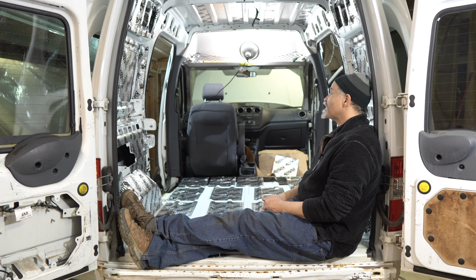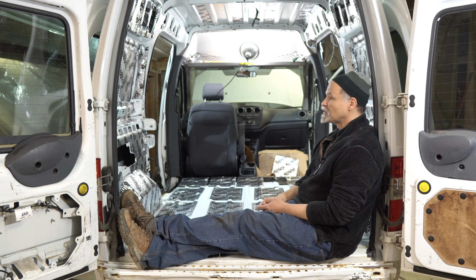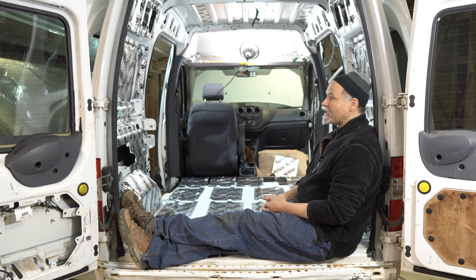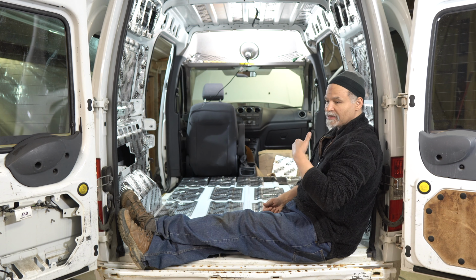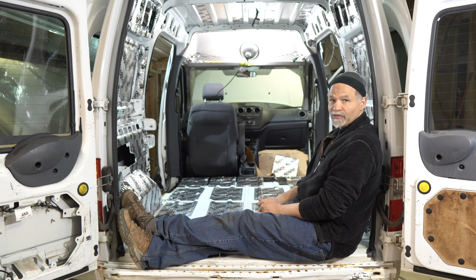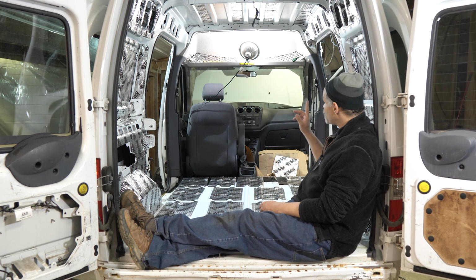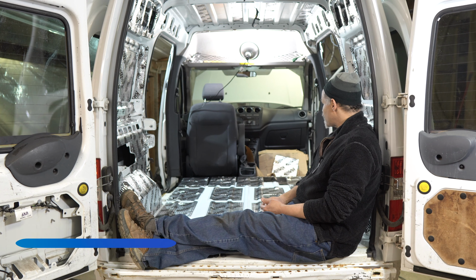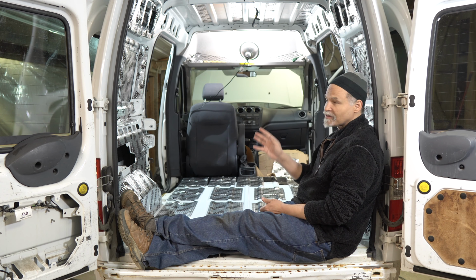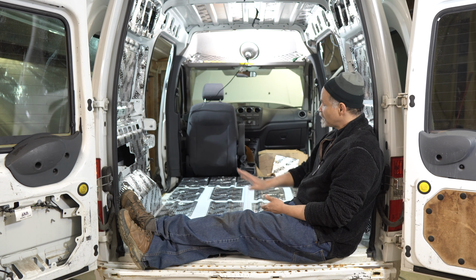That was a lot. I'm going to end the episode right here. I hope you learned something, or at least sort of understood how to install the sound dampening. So I should have mentioned something at the beginning, and it's so long ago at this point I can barely remember, that the recommended install is 30%. In my instance, because what I was hearing from other people and reading online, 30% is getting useless. 50% is probably better, but this is closer to 70% of the space, so not more is better. I just used everything, or nearly everything, and tried to map it down as much as I possibly could. There's some logic to this. I know it doesn't look like it, but it will become apparent when we start laying down the insulation and the floor joists for this.